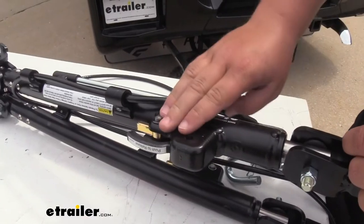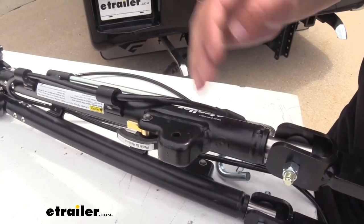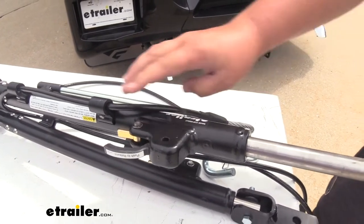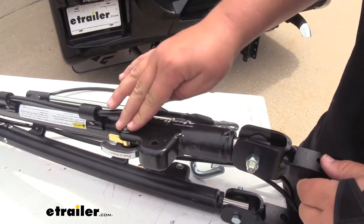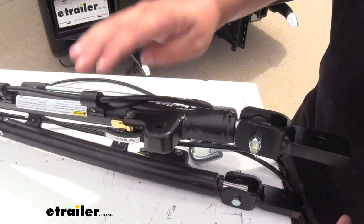Before we flat tow our vehicles, it's always an important step to check our tow bar. In this case we are missing our pin here. Luckily it was the top one, so it's still going to work properly, but that extra play might cause this pin to fall out. And if this bottom pin does fall out, this whole locking mechanism is actually going to come apart. So we did get pretty lucky.